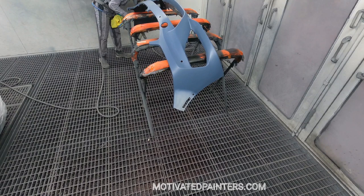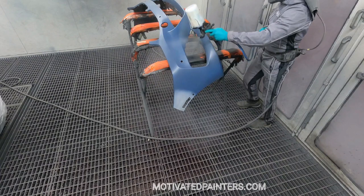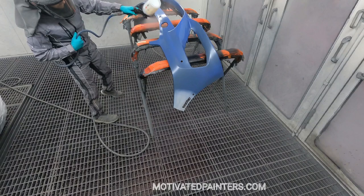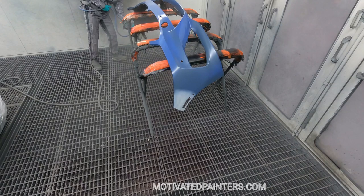So, I'm gonna do the same thing with this bumper, with the base coat application. I'm gonna do the wet bed. So I lightly put it on top of the primer, but not really. So I kind of faded it in. And then I put on like a coat and a half on where I'm not gonna put a lot of base. And this has been working so well, especially when it comes to blending colors. It makes it a lot easier, to be honest, blending the colors, from what I have noticed anyways.